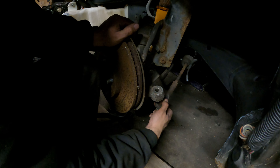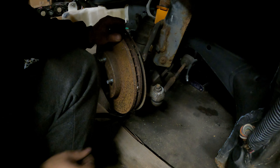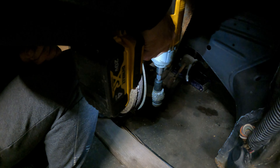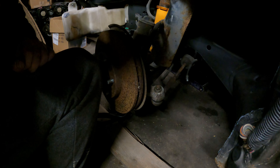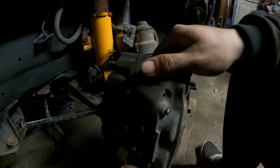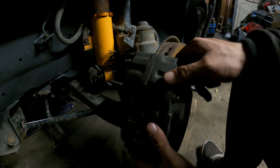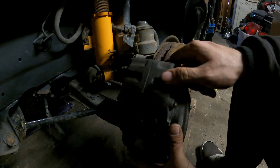Thankfully I still have all three of the extra calipers. All we're going to do here with this tie rod is put your nut on — I'm not going to torque it just yet, we'll go back over everything. For now that'll do just fine. We definitely need to compress the piston.